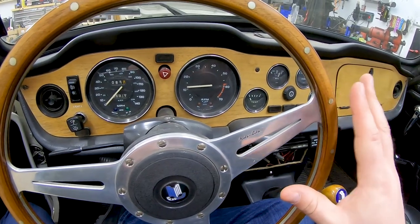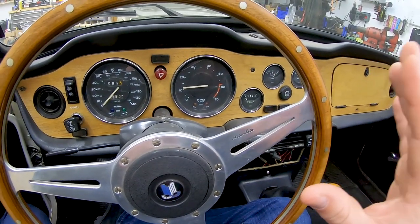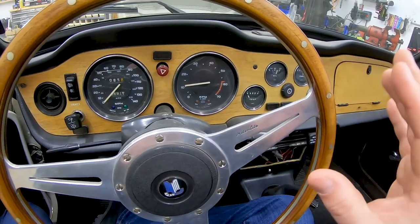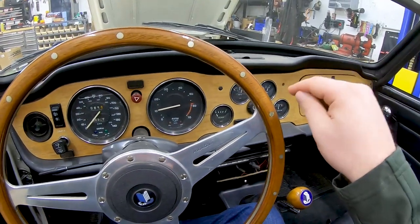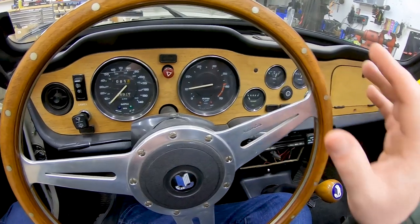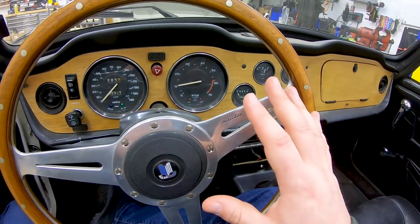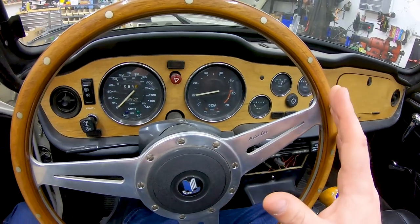Unfortunately I can't really take it for a drive right now because it's terrible outside, so I'll get a driving video of this car up later on. But it actually drives and responds really well. I did have an issue with the original TPS sensor that came with the kit being somewhat defective out of the box — if you have that problem, it may be an ongoing issue. But it was a generic GM sensor so I think it was just bad luck, and it was only about $15 to get a new one.